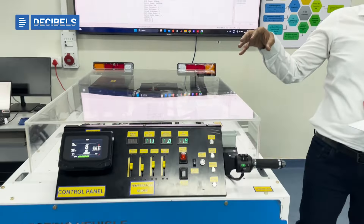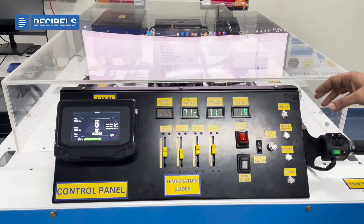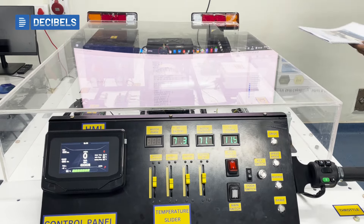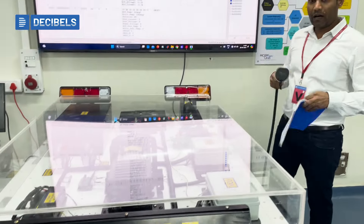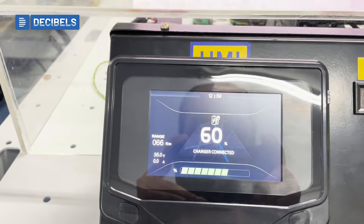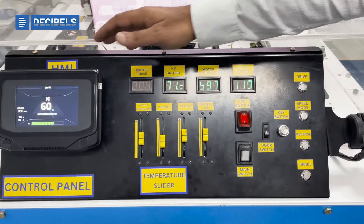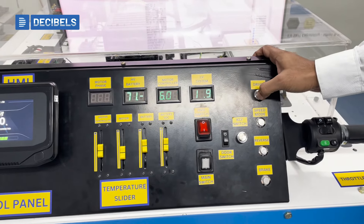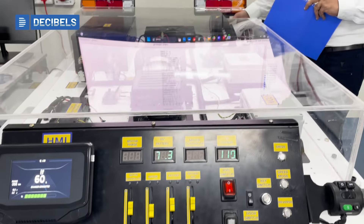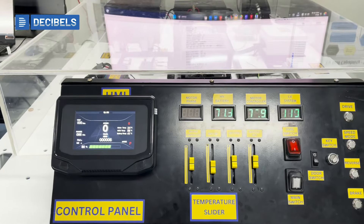To show you some of the data functions of the VECU — right now the vehicle is in parking mode. If you want to go from parking mode to drive mode, a lot of fundamental conditions need to be met. For example, if you have connected the charger to the overall system, the system should not allow the vehicle to move from parking mode to drive mode. You can see that when I connect the charger, the system doesn't allow any mode transitions — from drive to parking or any other modes. We have developed about 10 to 15 plus such functions integrated in the overall system.